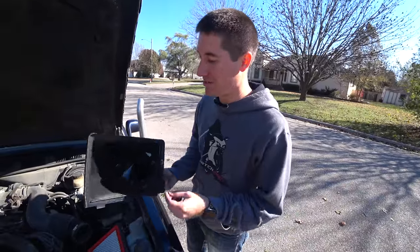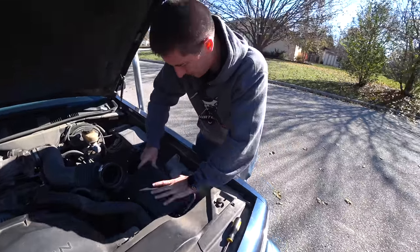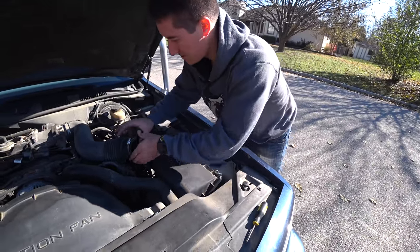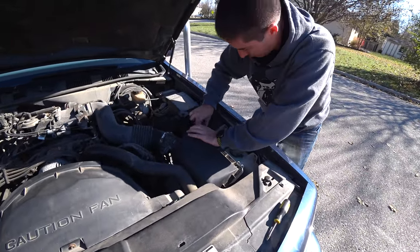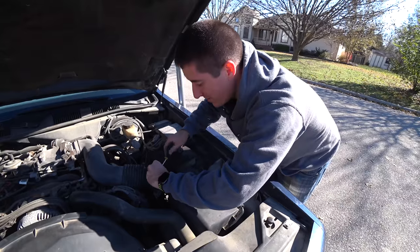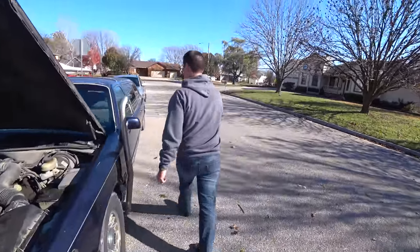Getting the cover back on the air filter and tightening down this worm clamp. It's 36 degrees outside today — it is actually freezing. We're out here trying to work on this and our hands are definitely losing movement. We had to take the intake hose off to actually get that on because it's a huge pain. Air filter's in. All that's left is these connectors and the intake hose — hook up the MAF, nice little click, and hook up the IAT, one more nice little click. All that's left is tightening down this worm clamp. Let's take this thing for a test drive! We're going to leave the air suspension off too — see how it looks when it's slammed. Hopefully it fires up, because it hasn't been running in quite a long time.